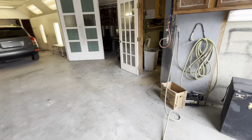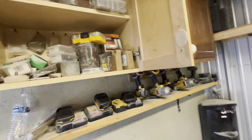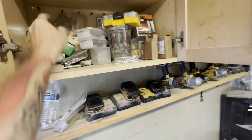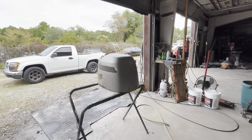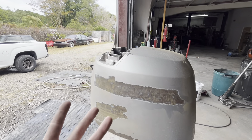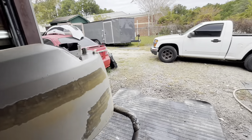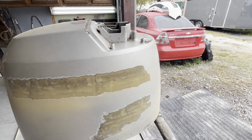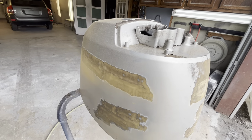You have your decals on the side and all that. What I used to do is try to use an eraser wheel — like we typically use on all our other projects — a big eraser in the shape of a wheel that goes on your drill. But the problem with these boat motor covers when they get this old is that the sticker has hardened and it just won't come off on the eraser wheel. So you really destroy the eraser wheel, and sometimes it ends up destroying the material around it.